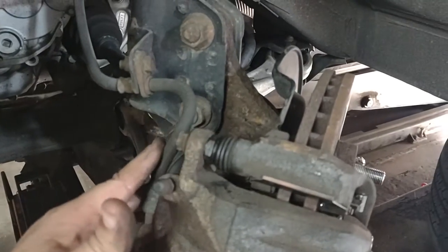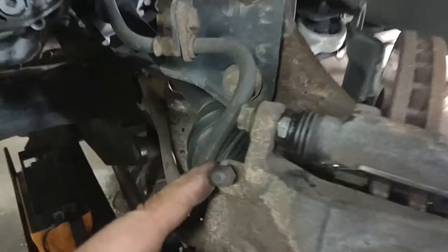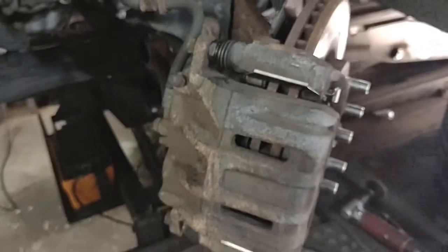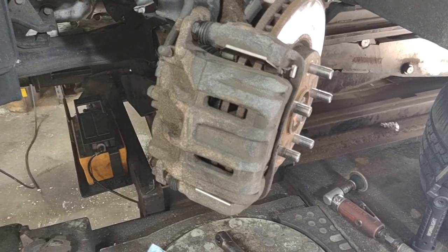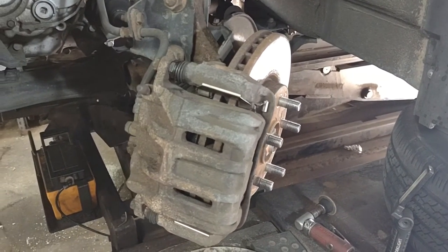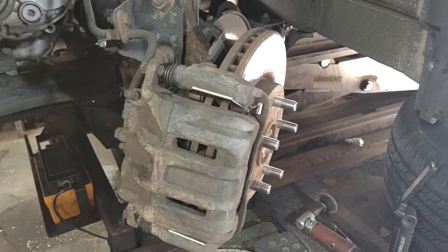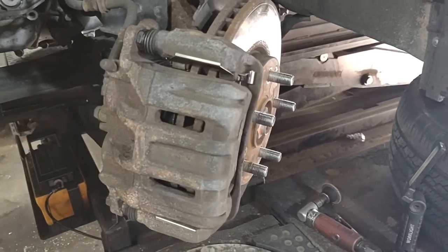In this case, since I didn't remove the brake fluid or open the bleeder or remove any hoses, I don't have to bleed the system. But if you open the bleeder or change any hoses, you definitely have to bleed the system. Most importantly — before you start the car once you finish the job, pump the brake a couple of times until you have a really stiff pedal. I can't say this enough: before you start the car, make sure you pump the brake when you're done. If you start the car and move without pumping the brake, you're going to have an accident.